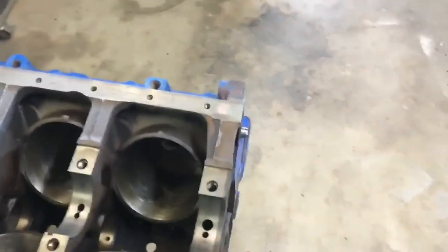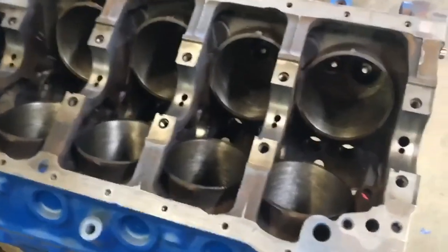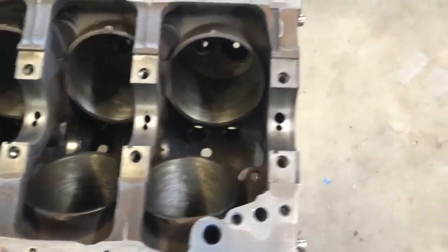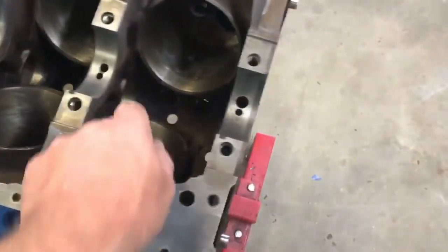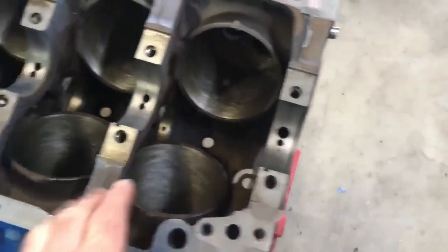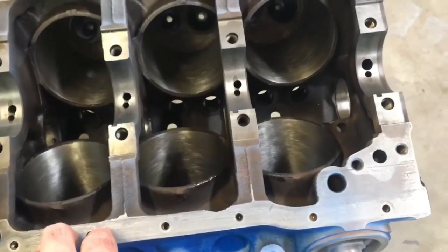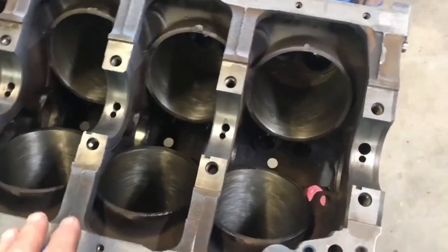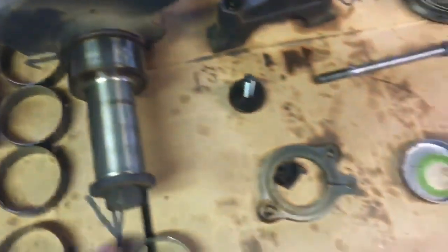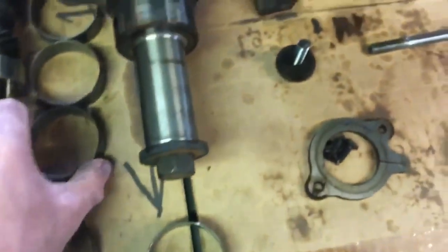Let's recap where we're at. We've got a bare block that we've stripped down and cleaned. We've honed the bores, done a little painting to protect from rust. I've gone through everything and assessed all the bearings. There are bearings in here that the cam rides in, and I wanted to talk about those. This engine had very few miles — it was in really good shape. Those cam bearings were in excellent condition. The cam rode smooth in them when I pulled the camshaft out. Where those bearings rode looked really nice — it sits in there and floats on them. And those bearings were in really good shape. You're going to see in the next video me removing the cam bearings.